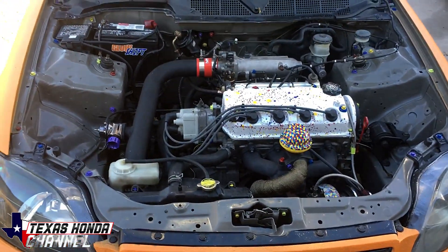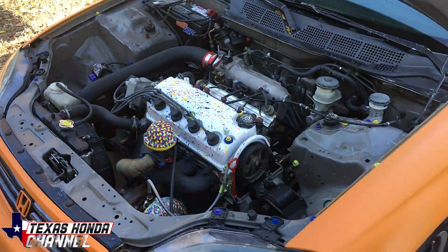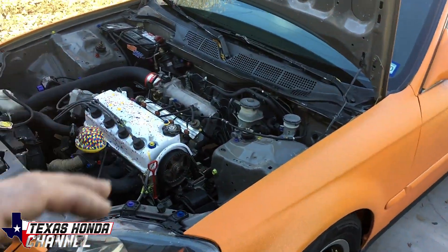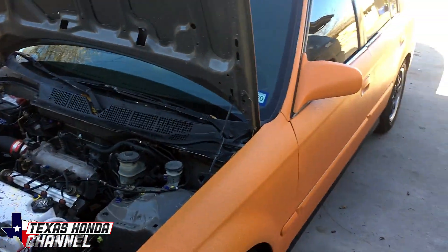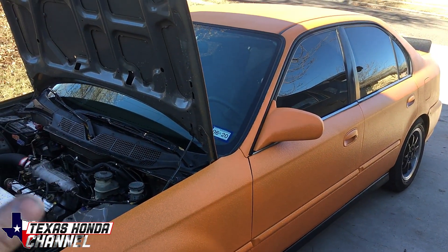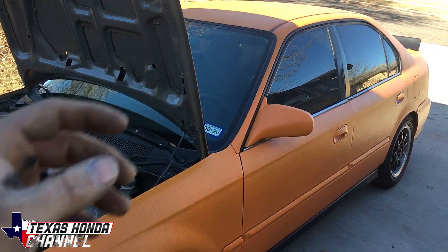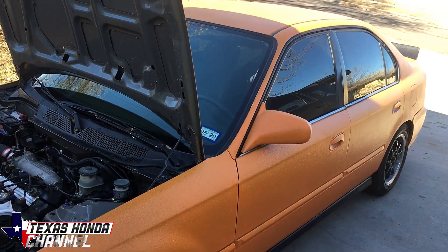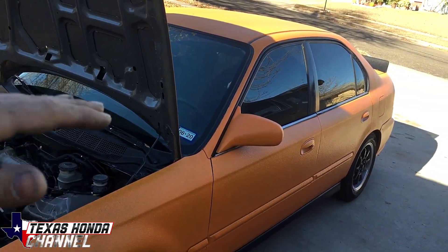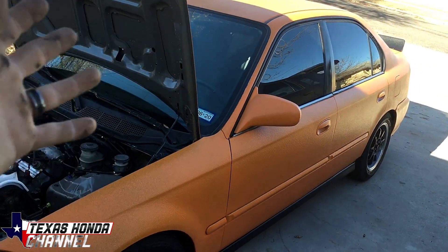Still pushing around the same horsepower. I did a little adjustments but it's nothing crazy. We put in the Walbro 255 pump — it's a genuine Walbro. It definitely has more power and pickup, and it keeps my air fuels right where we set them. Before I was having an issue with the fuel pump not keeping the air fuels right. Sometimes it would be at a perfect 12.1 or 12.5, and other times it would be at 13, which is not good — it just wasn't keeping up. Now with the legit authentic Walbro 255, it's staying right at 11.8, which is about perfect — in between 12.5 and 11.5. The air fuel ratios are rich but not too lean to where I'm going to blow my engine.